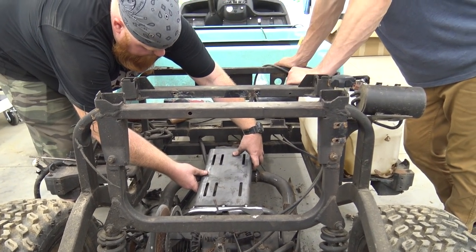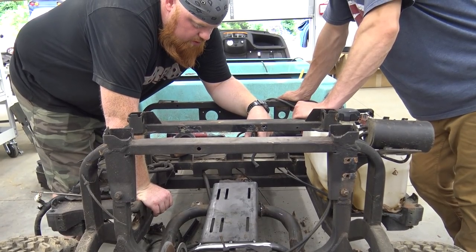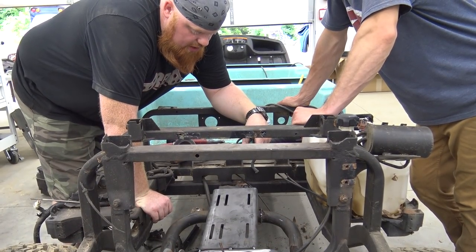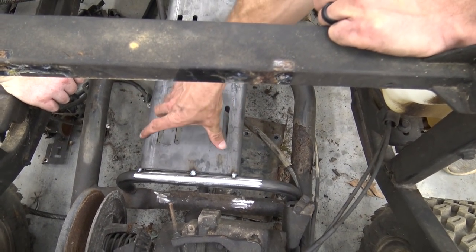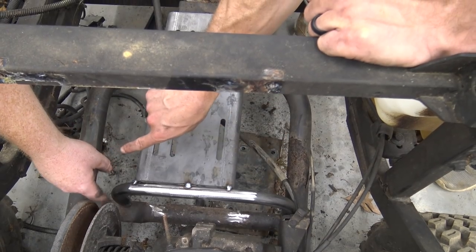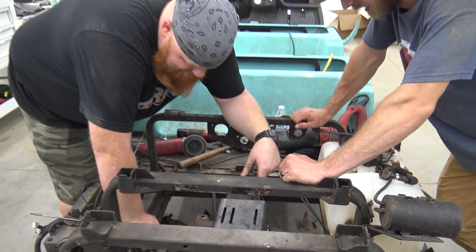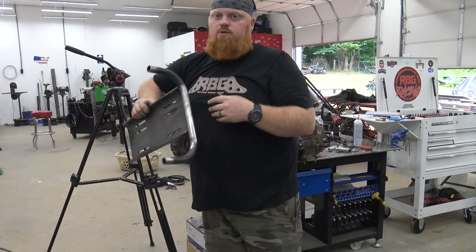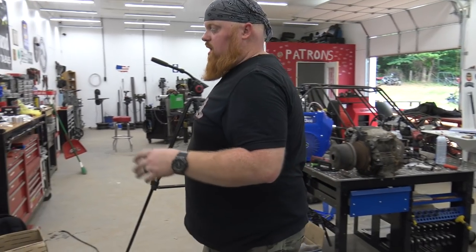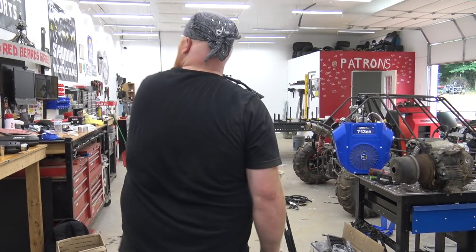Way too wide. So what he's gonna have to do is, if you cut the tacks and bring this, just slide that way. Yeah, okay, it's too wide. I get you. Instead of round tubing, because of the swooping bends, I'm gonna lose so much area. I'm gonna do it out of 1-inch square tubing, do 45 degree cuts, and weld them together like that.